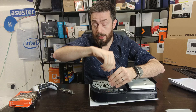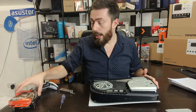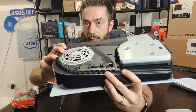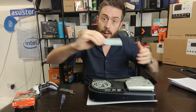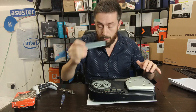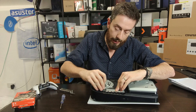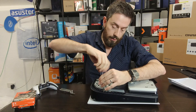It's worth bearing in mind that right now, because this expansion bay is not currently active, we don't know too much about heat sinks. Later down the line, you can get NVMes that arrive with a heat sink on top, as well as thermal padding. Right now there is a huge amount of space inside that bay on top of the NVMe, so there's probably room to pop a heat sink in there. Also worth highlighting, that metal plate is slightly dipped in, so there is room when installing. Once you're done, get your metal plate, pop it on the side, pop it down, and simply reapply the screw — righty tighty — and that's it.